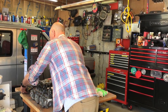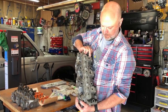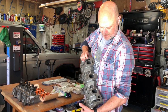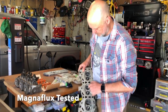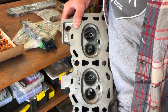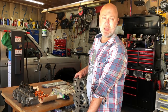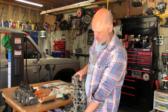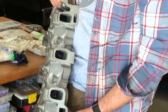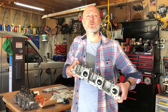That brings me to the heads. These 2.9 heads are notorious for cracking if they're the earlier castings. I was lucky enough — in an '89 — to have later castings that have the more rectangular seats for the rocker arms. The machine shop tested all these out and they were good. I ported and polished inside the cylinder heads for the valves — there were a few lessons learned there; I think I took a little too much out of the throats, but they'll work fine and get a lot more horsepower. I also gasket-matched the intake and exhaust ports, which took 8 to 10 hours of work with the pneumatic grinder.